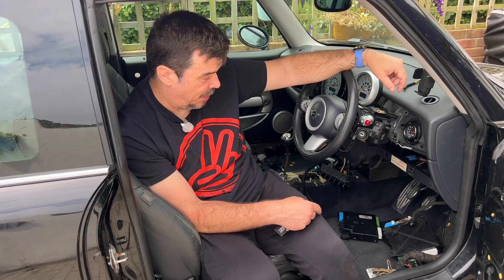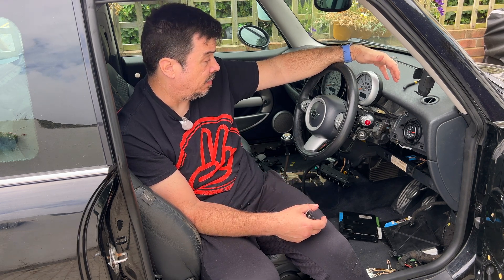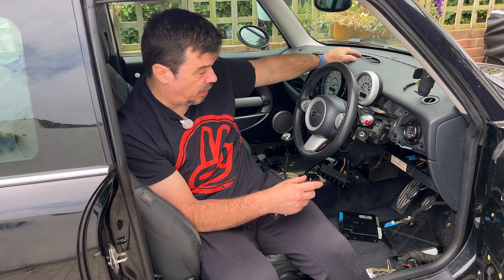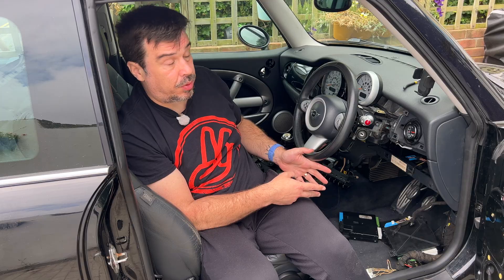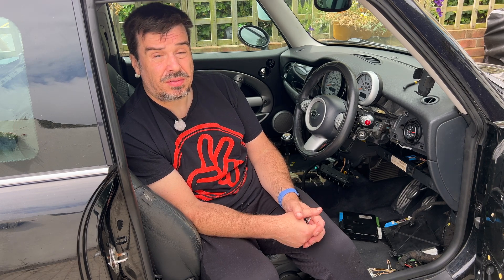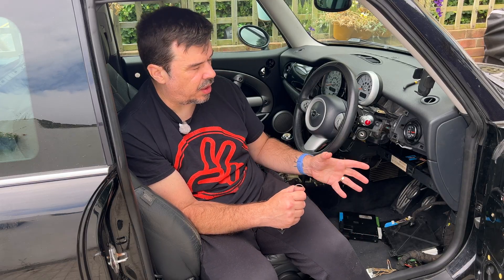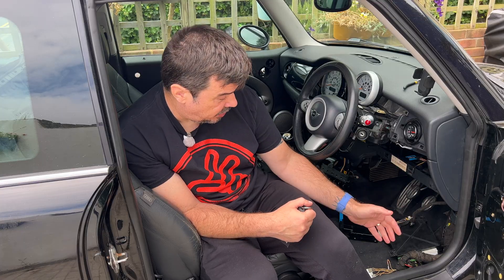I wouldn't have had to wait for a second BCM or stripped everything out of the car, but I have learnt a lot about how the BCM works, how the KBUS works, and how the accessories and options work in this car. If you're chasing electrical faults where lights aren't showing correctly and you think it's KBUS related, the BCM is the first port of call - it's an easy one to check - then straight down to this wiring junction box. The location of these junctions aren't in the service manual; you can see them on the wiring diagram so you know they've got to be somewhere in the car, but where is the problem.